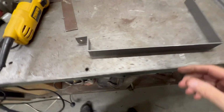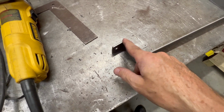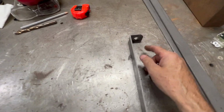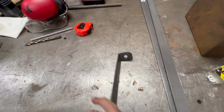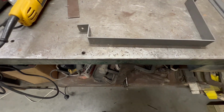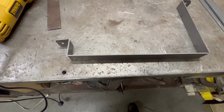Now on the outer part of the van, the frame rail is sloped down a little bit, so you need a little slope down there. And then this, you have to cut a little off of here to make sure it matches up so you can get it within the strap on the other one. Now I'll end up coating these with some Herculiner truck bed coating, and that way it protects them a little bit outside. Now 2 more to make.